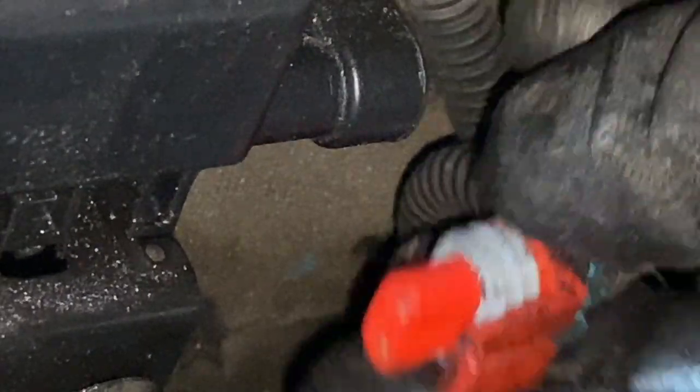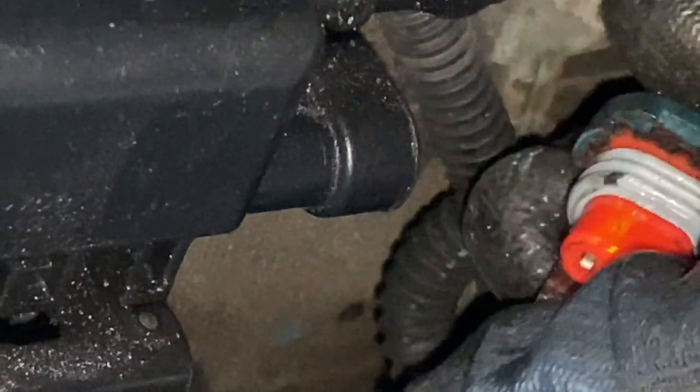Oops, that's on the bottom. Just pry that down. Pull. Little slip ring right here. Pull it up. Unless things are really dirty, the slip ring should be like a little white or yellowish piece of plastic that you're going to pull up, and while you're holding it up, because it might want to slide back down, pull the hose back off the fitting.